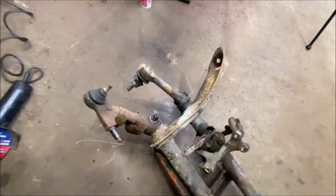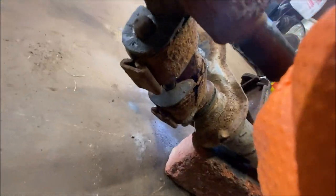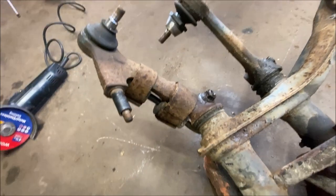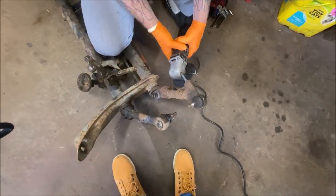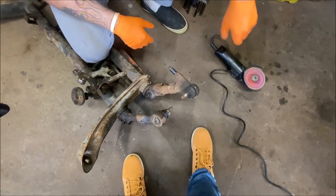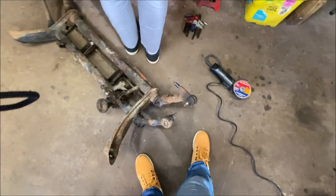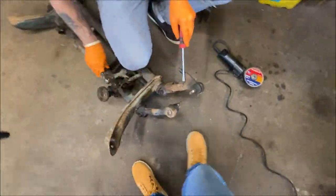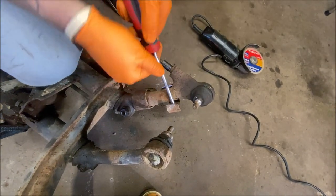Technically, to remove the sway bar, you come down here and you remove the slides off of here. See how they work? And then these come off. My one is already split, and these things have been on there since 1968. So I'm cutting them and putting new ones on, and we're going to go to a three-quarter inch sway bar anyhow. Now you've got to watch you don't start cutting your arm in half, but I only nicked it so I wasn't really worried about that.